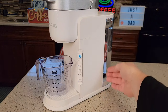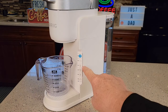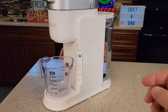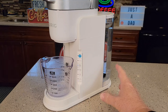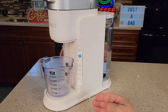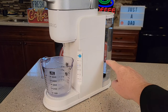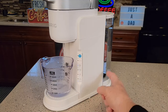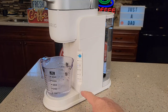I've got this filled up with fresh water. As soon as you put it back on, the add water light is going to go out and the 12-ounce button is going to start flashing again. Press the 12 — this is a fresh water rinse. It's very important that it never comes out of descale mode. If it does come out, or you hit a glitch, you'll have to unplug it and start all over. Next time you start, you can just use fresh water — use that proper amount: 14 ounces solution, 14 ounces water — put it in descale mode and complete it, because you need the logic of the add water light coming on, then completing the fresh water rinses, and then it will turn the descale light off.